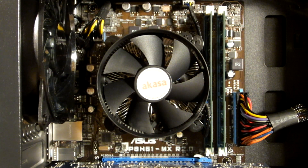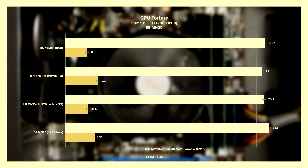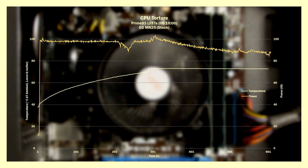Testing consists of a simultaneous CPU and GPU torture workload to simulate a worst-case scenario. On the CPU side, load temps across the MN25 setups hover between 72 to 75 degrees Celsius delta T over ambient, within margin of error of each other except for the four-fan setup. If you want to know how these perform in your room, just measure ambient temperature and add it to these figures — meaning at an ambient of around 20 degrees, all of these setups will have thermally throttled.